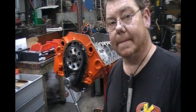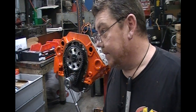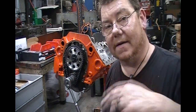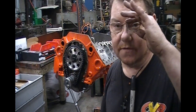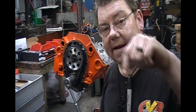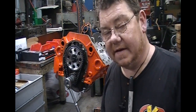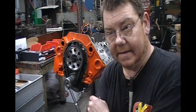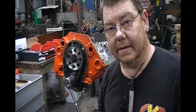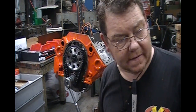I'm going to show you the easiest way to do it. There are several different methods, but the way I do it, I use the clay method, because it's easier for me to check the radial clearance as well as the depth. They typically say you want at least 75 thousandths on the intake side and usually 100 thousandths on the exhaust side — I just say shoot for 100 thousandths straight across the board.